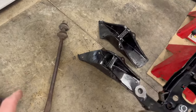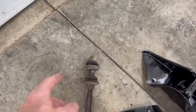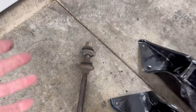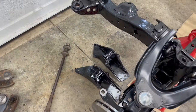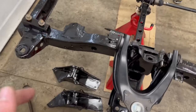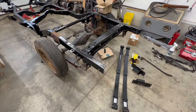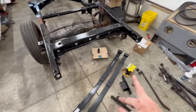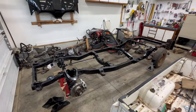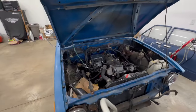The last thing I was going to do today was install the strut rods. However, I received the Polyurethane bushings to replace these old rubber ones and they weren't even close to being the right size, so I'm working with Polyurethane to figure out what went wrong there. I'll be installing these in the next video when I do the steering. Then I'll be installing the rear suspension which uses lowering leafs and mini notches, and then I'll finally have a rolling chassis. I can pull the drivetrain from the rusty truck and put it onto the frame. Thanks for watching.